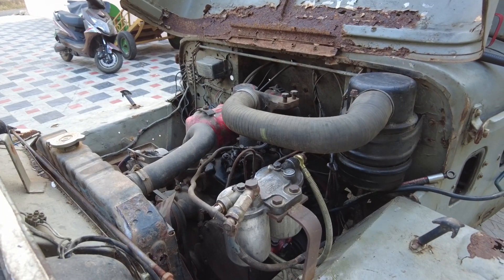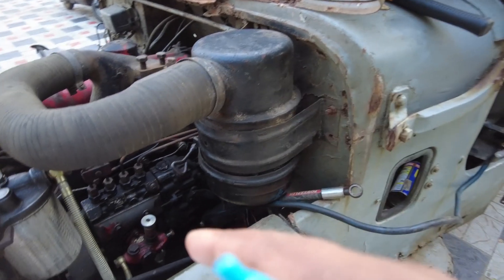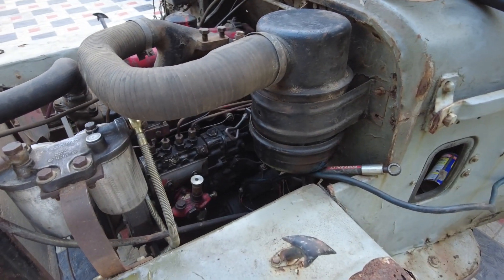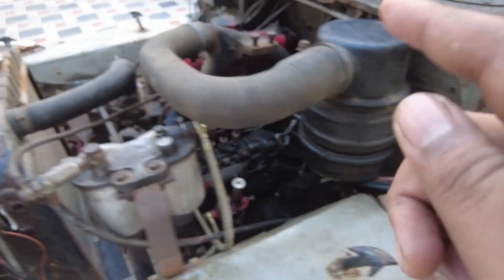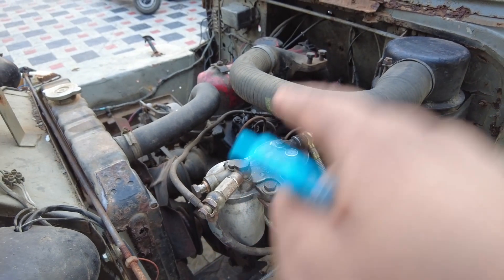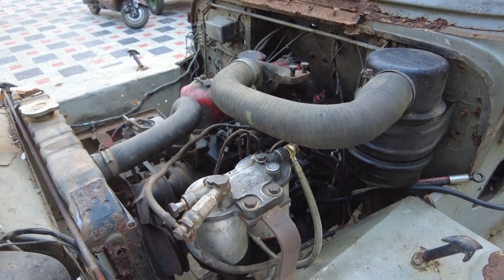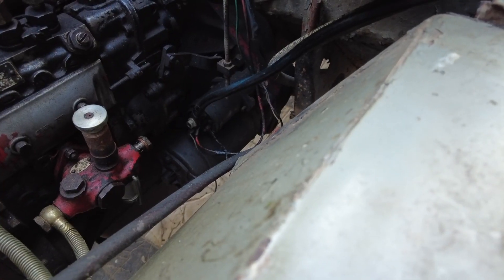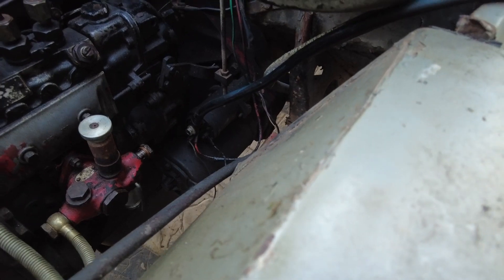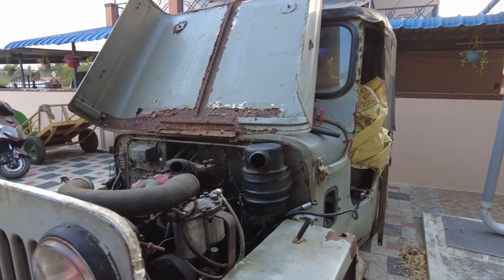I think the best next step would be to remove the head, measure the bore, and see if the B275 specs match what I'm seeing. I also plan to pull out the starter and service it — it sticks a lot. When I crank it and return the key, the starter motor still keeps turning, so I think the solenoid is sticking and I'll need to rebuild it at some point. It's been a couple of months since I made a video — I'll try to make sure the next one comes a little sooner. That's it, guys — bye.